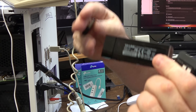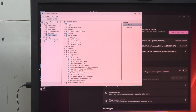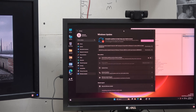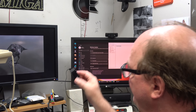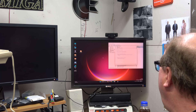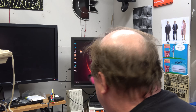I'll wait for Windows updates to finish downloading — it's .NET Framework and cumulative preview update for 24H2, with 70% memory utilization. That's why you want the 8 or 16GB model. I also have some old adapters: an ASUS one, a Netgear, and another TP-Link. Trying the ASUS one — double-clicking to update driver, searching Windows Update. None of them do anything when you search Windows Update. So the three adapters I own that work perfectly on regular Windows will not work on Windows ARM — but the UE330 does.